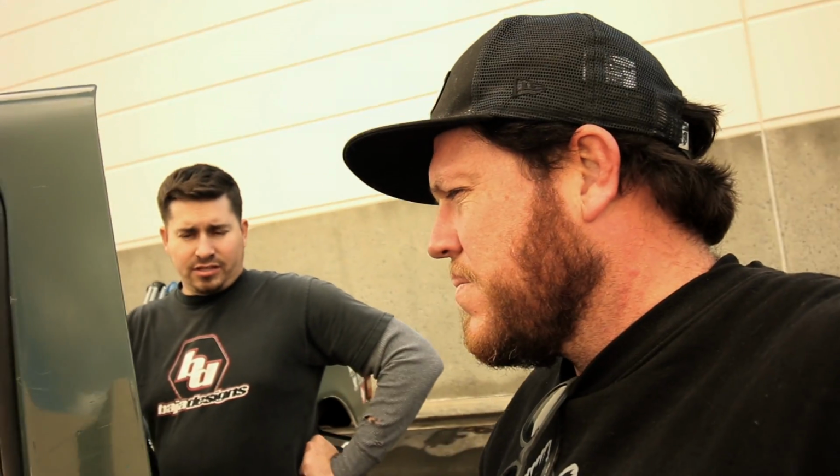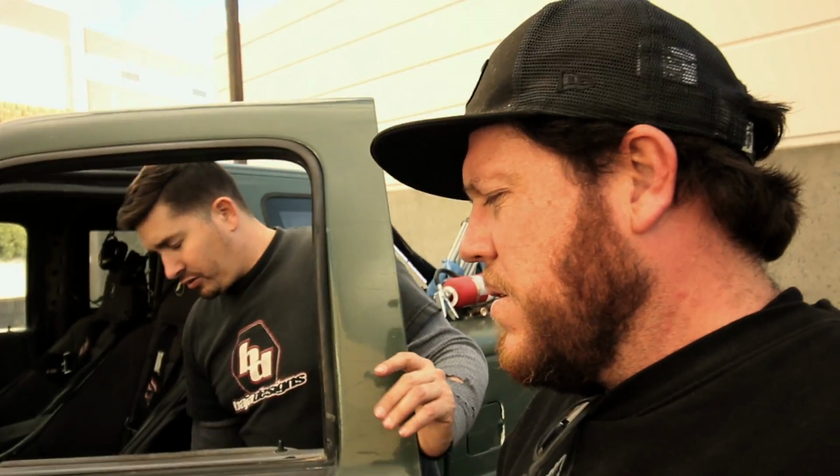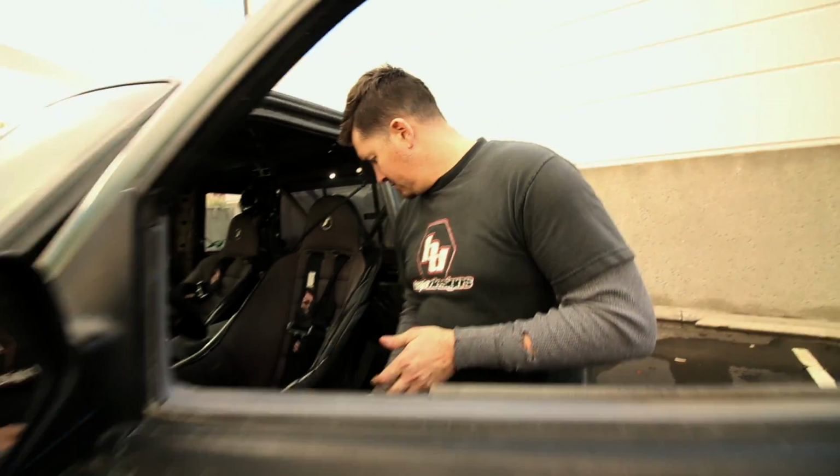So on the new lights we're going to, because when you're running all of that amperage through a switch, most switches are not able to handle that much current, and so you use a relay as the in between, so that the switch is just a trigger for the relay. All the power goes through the relay out to your lights. So yeah, pretty simple. Really excited with how everything's working.